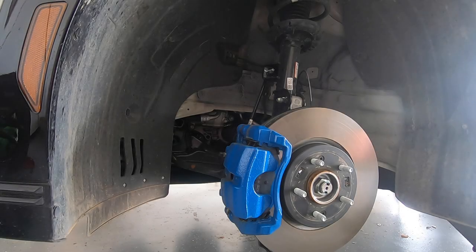First step: you're going to make sure you jack up the car on both sides because the sway bar will have a lot of tension on it if you don't. My car is jacked up on both sides. I'm going to first remove the sway bar end link nut, and that is a 17. My friend let me borrow a really nice impact that has honestly made this install 14 times easier. Everything is still fairly new, so let's get started. Everything just comes apart pretty quickly.